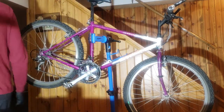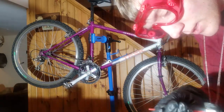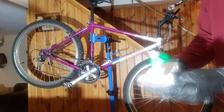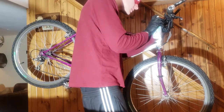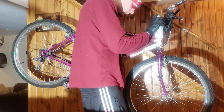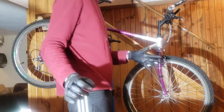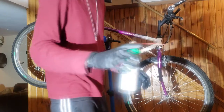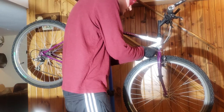I'm going to get my spray. I'm back - I got some semi-dry bicycle chain lube; we can't do the spray for this. So I'm going to stick the straw in there and spray that into the cable housing. It just can't be done prematurely. Dripped off the other side, so we now know it's completely saturated. Going to spray a little bit up in the shifter as well - yeah, it's got some in there. It is completely saturated.